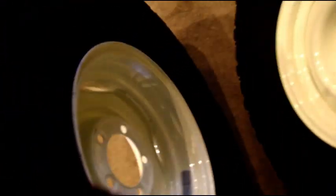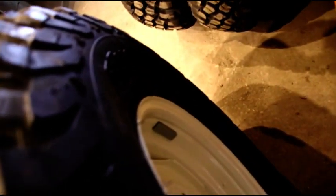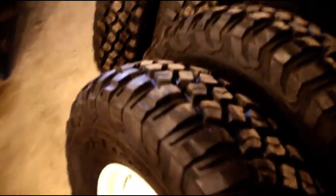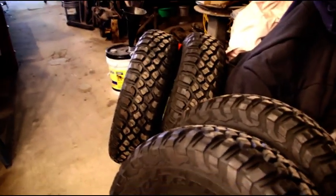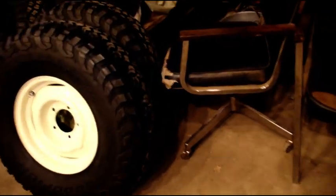They do have a tremendous amount of weight on them. And big tires, mud terrains, you know, you get them. But that tire has got 6 ounces on it, so that's going to be a rear. Let's see what this one's got. I got a couple that only have... That one's got 2, so that's going to be a front. And I'll pick the 2 best for the front. I'll pick the worst one for the spare, and the 2 in the middle for the rear tires.